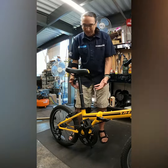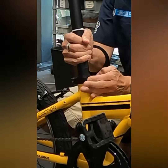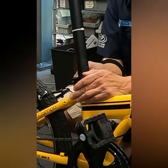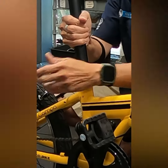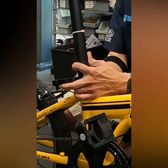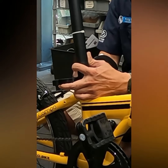The easiest and obvious solution is simply open the quick release first — always open the quick release first, because we get a lot of customers that say they cannot adjust it, it's already tight, they have to use a wrench. If you open the quick release, it releases all that pressure that's binding the seat post, and it makes the little knurled nut on the opposite side much easier to turn.